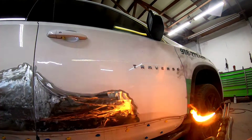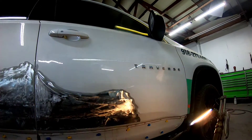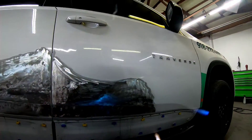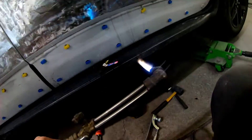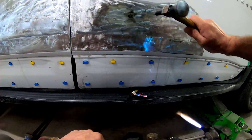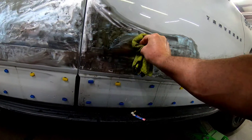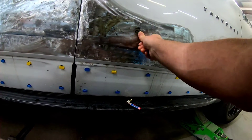We want that panel to be firm and solid. The reason we want that is because when you've applied your body filler and you're blocking it out, if that panel is flexing, it's going to make it near impossible to get that panel straight. So I'm feeling around this panel, finding the area that is most flexible — that's where we want to shrink this metal. What we do is take our torch, heat up the center in one small area, and then give a good tap with the hammer. You can see that panel went in, but as I cool it with a wet rag, it's going to pop back out — and that is tightening up that metal, starting to firm it up.